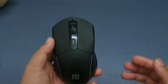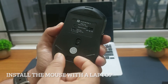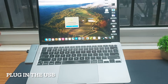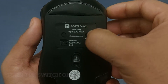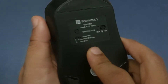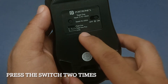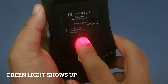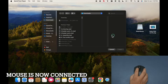Next, let's install it with a laptop. Take out the USB receiver from the slot of the mouse using your index finger, then connect it to your laptop's USB port. Go to the mouse and turn the switch to the on position. Press the switch twice to connect to the nano USB receiver — you will see the green light showing that it's now connected. As I move the mouse you can see the cursor moving simultaneously.